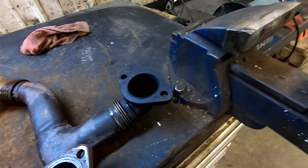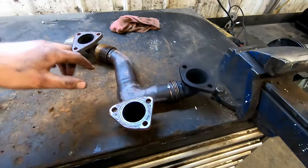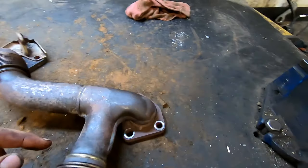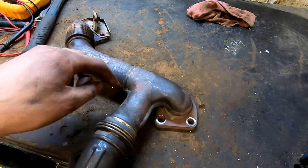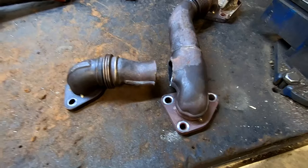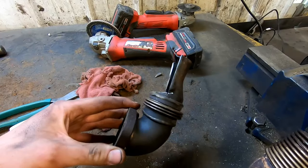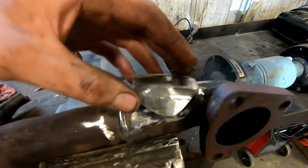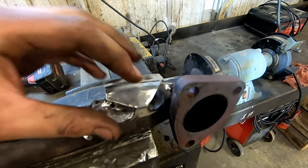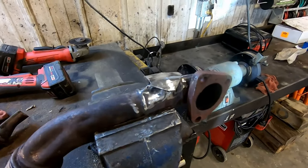There's the up pipe. This part here that goes to the EGR cooler is where they like to blow out — that's why it's best to just get a new up pipe without this on it. In this situation, I'm actually going to cut this branch off right here, take some of that metal, and weld it solid to cap it. I'll buff up the edges all around it so the welder welds nice, tack weld it, heat it with a torch, hit it with a hammer to mold it around, then weld it all the way up. Once welded, I'll throw some paint on it so it doesn't rust.